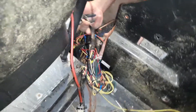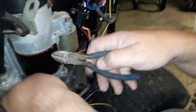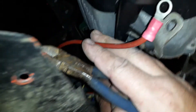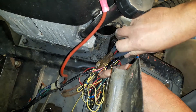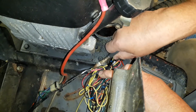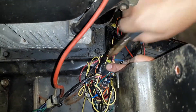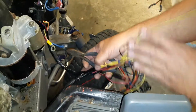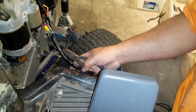The only thing I'm cutting now is this line goes to this box on the side of the engine right here, and they follow this thing back down. This is the positive that used to go under the solenoid, and this wire — the black goes to that one loom, the yellow goes to that loom, and the red went to that loom. Then I get this whole cluster of stuff on the bottom that I just didn't really know about until now, so the fun never ends.